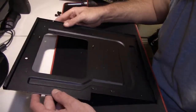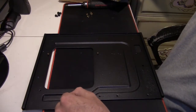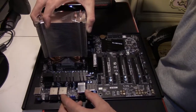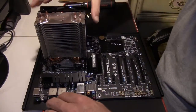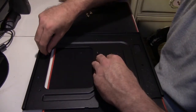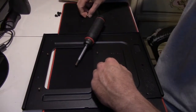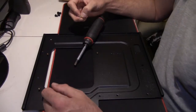Next I pulled the motherboard tray out of this case to make things easier. We're going to put the motherboard standoffs in and attach the motherboard to the tray. Set the motherboard down and line it up to see which holes need standoffs — this case already has two, but an ATX motherboard needs a total of nine. Cooler Master includes a metal tool that fits on top of the standoffs. Go around, figure out your holes, and put the motherboard standoffs into your tray. If you don't have a removable motherboard tray, you'll have to do this while they're still in the case.